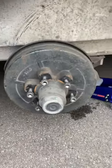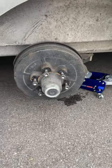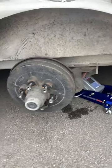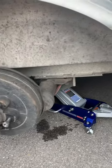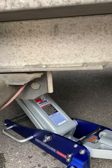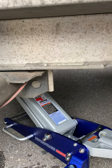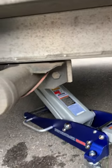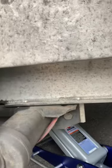Running into the frame. The reason that happened is this trailer is all aluminum. It's my first all aluminum trailer — it might be my last — because with aluminum framing you can't do anything other than put an aluminum mounting plate and weld that to the torsion axle. So that plate completely broke off.